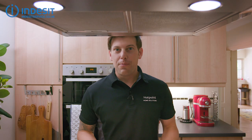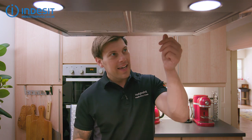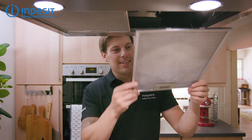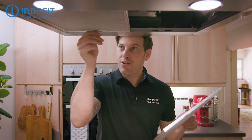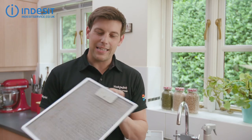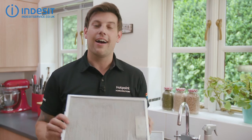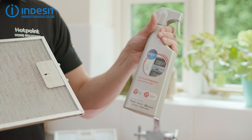It's really important that you wash your metal grease filter regularly — ideally every three months — as you don't want fat dripping down onto your food while you cook. As you can see from mine, they're in need of a really deep clean. To do that, I need to remove them, and in most cases they simply unclip. Cleaning these filters is incredibly easy — I recommend using a professional degreasing spray like this oven and grill degreaser from W Pro.